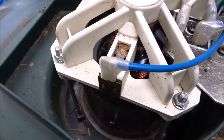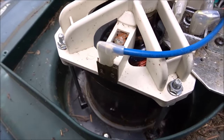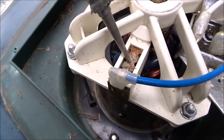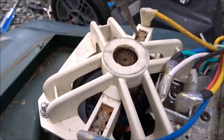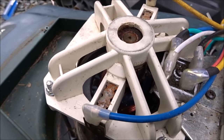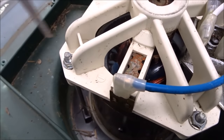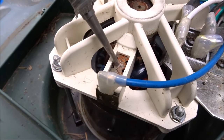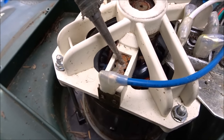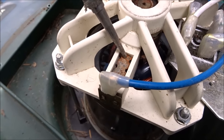Generally with a lot of electric items like lawn mowers, when they won't work, what I find is that the points are gone. That's basically what these things are here. Your electricity comes in, goes there and there, and it's transferred through here going to your motor. What happens is that the little graphite bar in here sticks inside the sleeve.